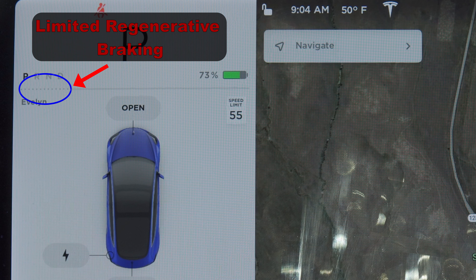First up, if it's below 40 degrees Fahrenheit outside, preheat your cabin whenever possible. You can do this right from the app and don't even have to go out to the car. I personally aim for about 30 minutes before I plan to depart — I find this gets the juices flowing and warms up the battery a decent amount. If it's extremely cold, say less than 20 degrees Fahrenheit, you might want to go even longer. There are two big benefits: you should have most of your regen available once you start driving, making the experience feel more normal and safer, and your overall efficiency is going to be pretty good — not nearly as drastic an impact from the cold.